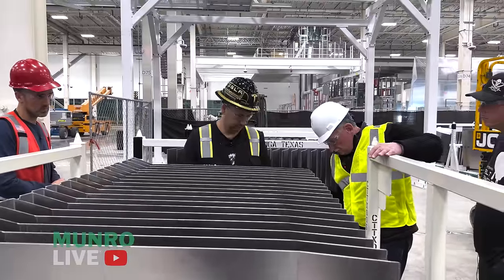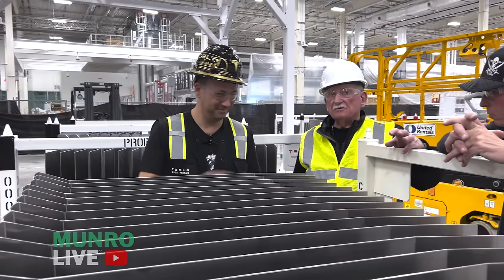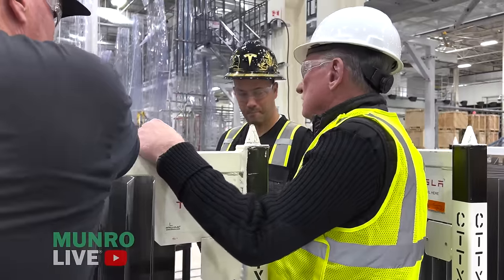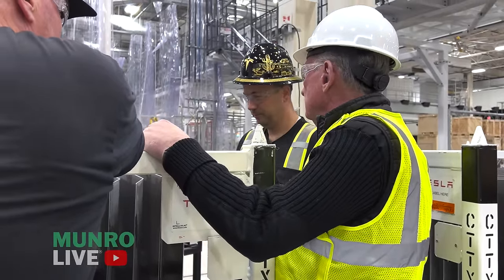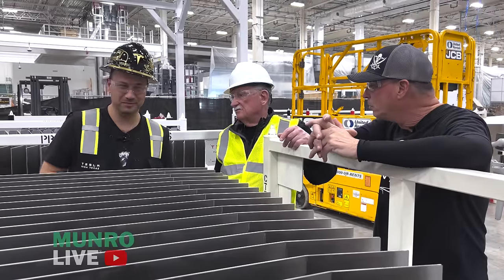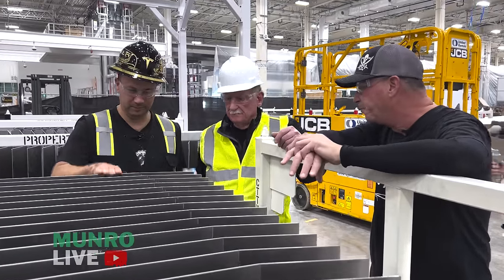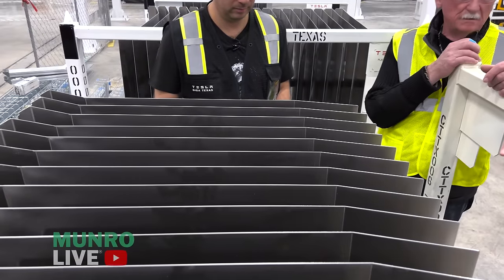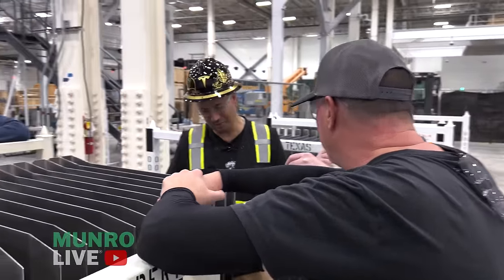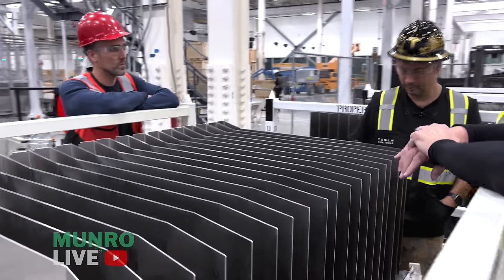That's pretty amazing. You're using three of my favorite suppliers: Trumpf, Kuka, and Schuler. These doors are 1.8 millimeters thick — the full real bulletproof panels. Everything else is 1.4 millimeters. The 1.4 is actually pretty bullet-resistant too, but the door outer takes about 75% of side crash loads just through the panels themselves, so we needed that extra thickness for stiffness.